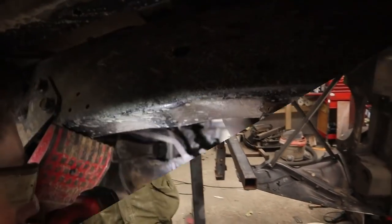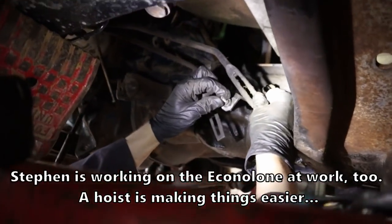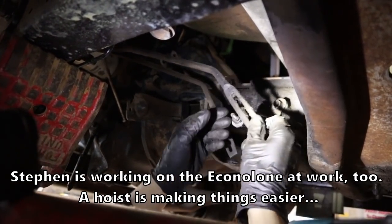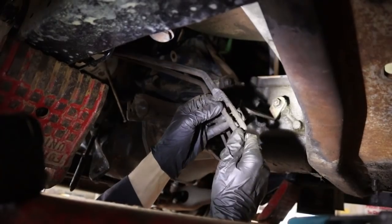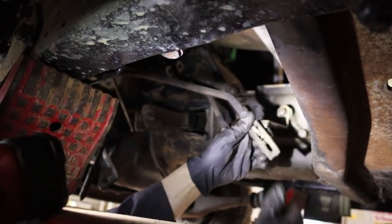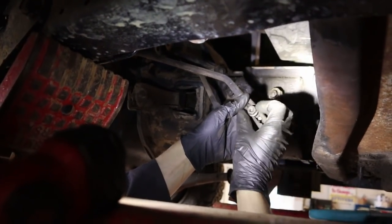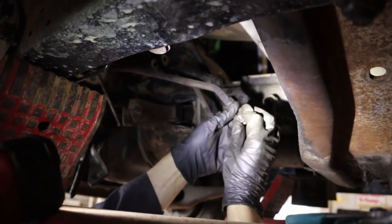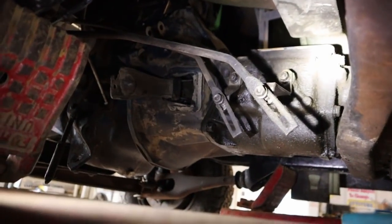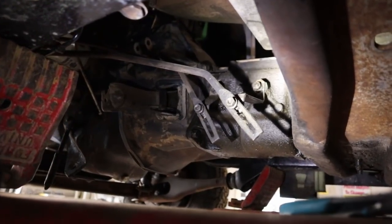You know it. There's the repaired linkage going back in. Oh, look at that. Down to zero now. That is nice. And it still rotates. Now we see why it has to rotate. There we go. Something like that. I'll have to adjust the clutch later. Clutch is in. Transmission's back in, roughly. And now you've got linkage, the drive shaft, just everything else. Just put it back together, basically.